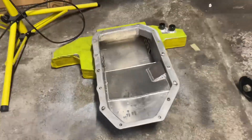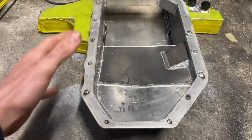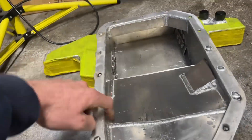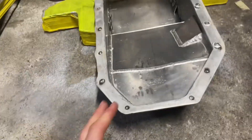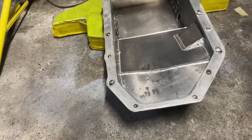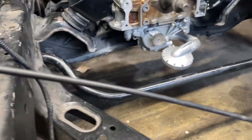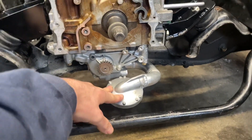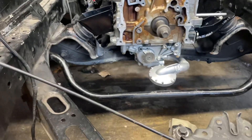The main problem was I used too thin a material. I had it clamped and bolted to the block when I welded the outside, but when I welded around the other side I didn't, so it ended up shrinking. I managed to get it to bolt up but it was fouling on bits of the oil pump, and it just wasn't going to work. I want to be totally confident in this so I'm going to scrap that.